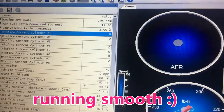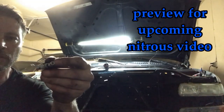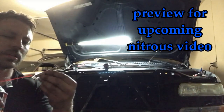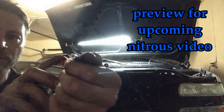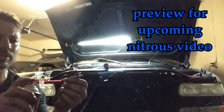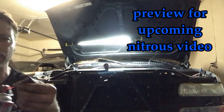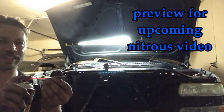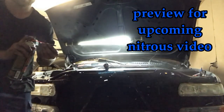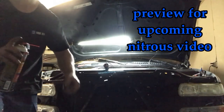It's running smooth and as you can see there are zero misfires. When the nitrous comes out — this is a single nozzle — when the fuel comes out it comes right through the middle there, through the large hole, like so. And when the nitrous comes through, it comes through the outer holes, you see. I don't want to spray my foam, but I'll step back and do it again. Nitrous — outer holes; fuel — center hole.